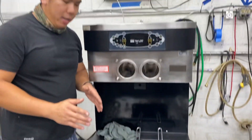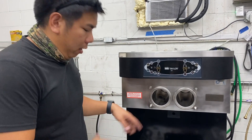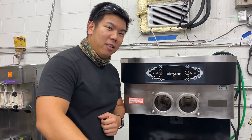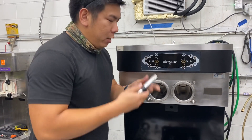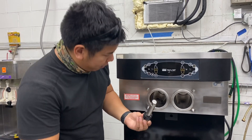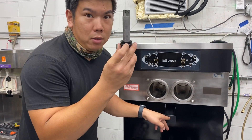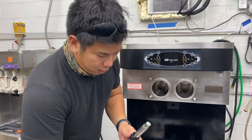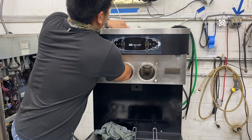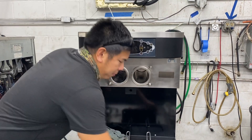Let's start from back to front in terms of reassembly. We're going to show you how to put everything back in — assume everything is clean. We have our beater shaft, the O-ring, and the beater shaft seal. If the seal goes bad you'll have product coming out the back and leaking through here, so if you see a lot of leakage there, check this part. Lubricate it, insert it, turn and lock, make sure it's all the way in. Repeat that with the other side.